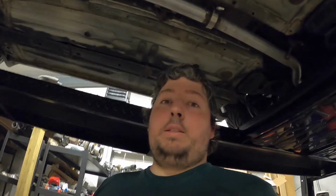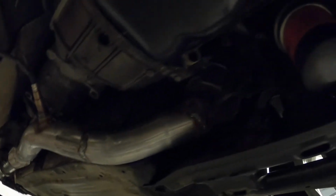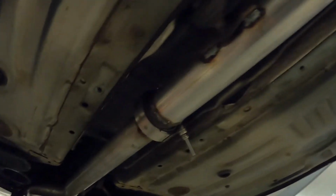Okay, got the exhaust done. It is kind of simple. Probably gonna have to shorten up that V-band bolt, maybe tuck it to the other side. Just plain as can be. Use the stock flange, stock gasket, O2 sensor now added in, flex joint, and we're actually 2-inch the whole way now for all the little bends there are. So let's get down and see how it sounds.